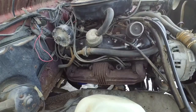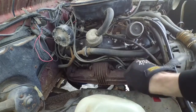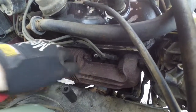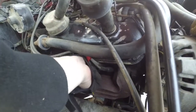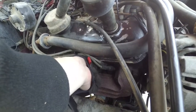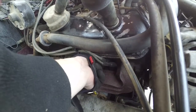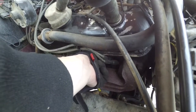So it's a 13-sixteenths. Don't have a spark plug socket for it, so I'm using an impact — it'll work nonetheless. Put the socket down there and we'll just hand thread the plug out. I'm hoping I'm not going to see a lot of buildup on them. I can see there's a little bit of rust on the bottom of the base of the plug, which is partially indicative of how long they've been in here, but might not mean they're bad.